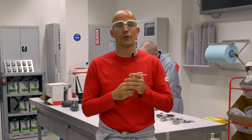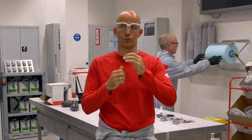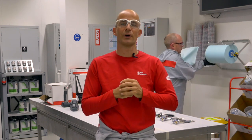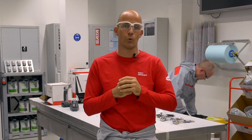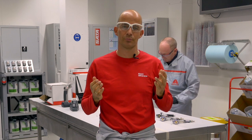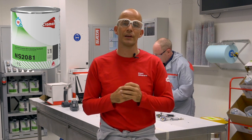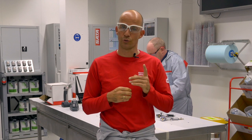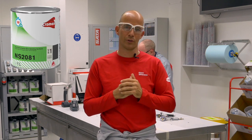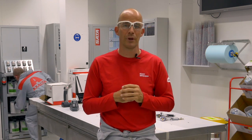Tony has prepared a car ready for PS1081 4 or 7 ultra performance energy surfacer in the correct value shade. In case of any bare metals, he will use PS1800 metal pretreatment wipes, which replaces a wash primer, thus improving productivity. The second part of the job is a new bonnet to be coated with NS2081 4 or 7 ultra performance non-sanding surfacer, which for this car is a real value shade one. This delivers the fastest turnaround for new parts and the shortest possible paint process available.